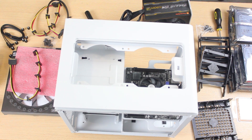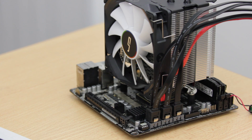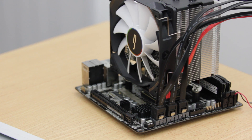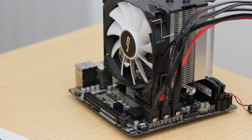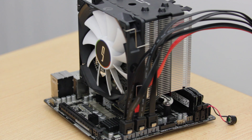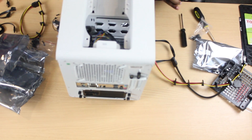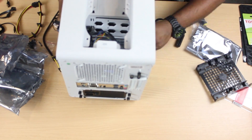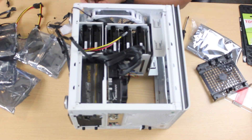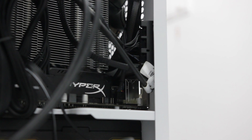To make this into version 2, I dropped in a few other parts after running the system for about two weeks. The biggest change was upgrading the CPU cooler from the stock cooler to a Cryorig H7. Temps are slightly lower — about five to seven degrees Celsius under load during transfers — but the real win is the reduction in noise. The H7 sounds no different under load compared to idle, whereas the stock AMD cooler sounded like a jet engine during file transfers. I could honestly hear it from 20 feet away in a separate room.